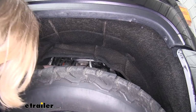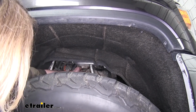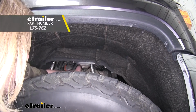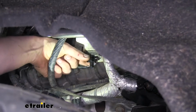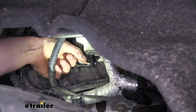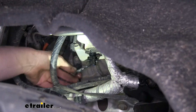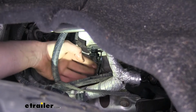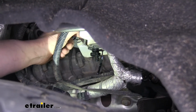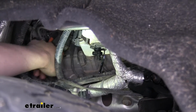So we're going to begin by draining the fuel. We're going to unscrew this, and I'm just starting it here. We want to make sure we have a drain pan located below it before we drain it out. We'll unscrew our drain here at the bottom, let the fuel drain out. While that's draining, we'll unclip the electrical connector that goes to our water separator. Once we've got that done and it's drained, we can now unscrew our filter.